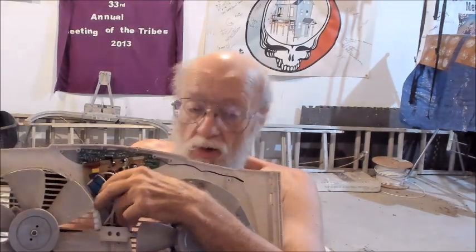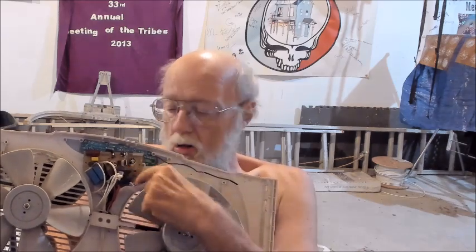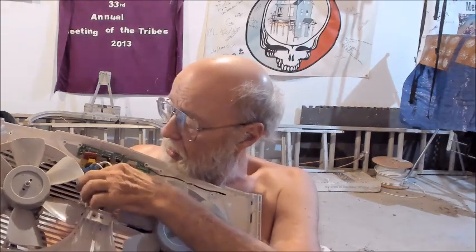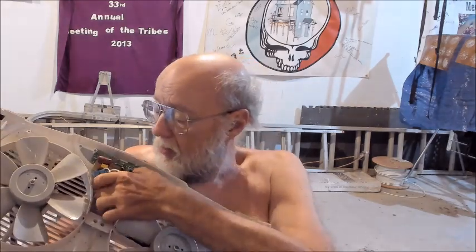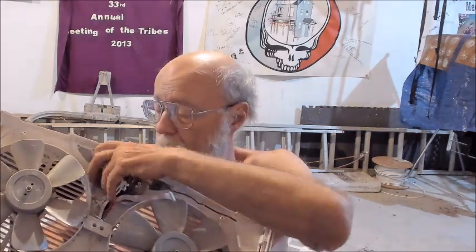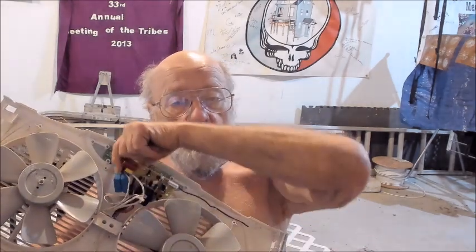So on this board, when I got to looking around, these things are UL approved, Underwriters Laboratory. It has to be protected in some way. Remember, the cord said it was. There wasn't a fuse in the cord. So I come up here and start looking around this board, and sure enough, it's actually, let's see, over here on this side, I believe. But there is a fuse soldered to this board. Yep. It's a little teeny black component right there with my thumb on it.